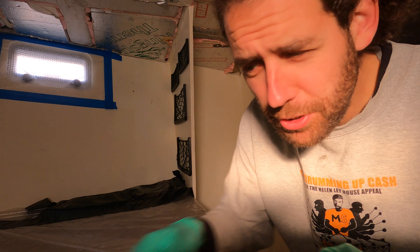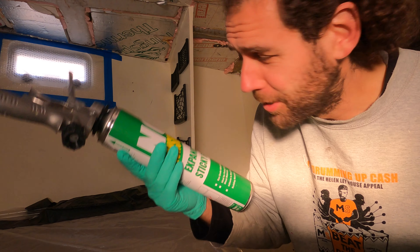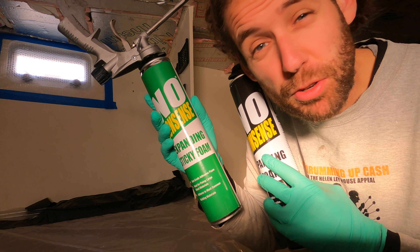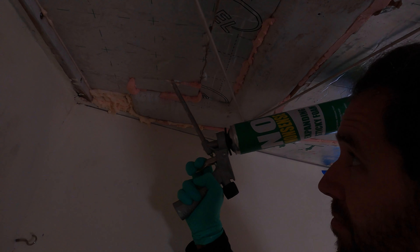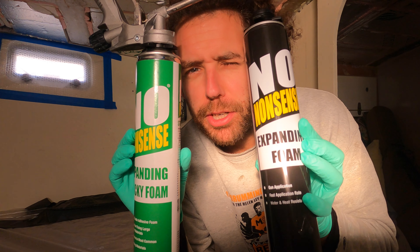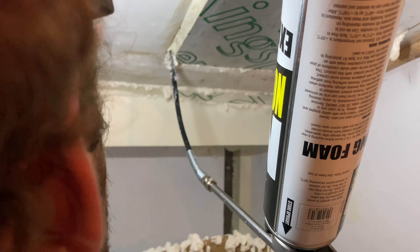This is the stuff I'd often use. For this go I thought I'd splash out and try the fancy stuff — a couple of quid more, supposed to be stickier, good for sticking panels to the ceiling. Turns out, not worth the extra money — I'm going to stick with the basic stuff. With a bit of spray, it's pretty messy, which is good. I reckon about two cans worth, so 12 quid's worth of foam — 100% worth doing if it means there's no drips anywhere ever. This half of the boat is properly insulated.